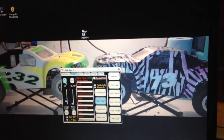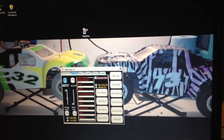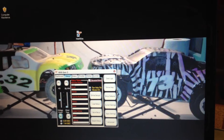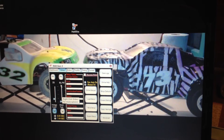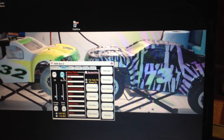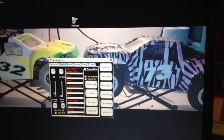Right here are up and down arrows — not V's. You can click them to cycle through your options. It will tell you your voltage cutoff; I'm going to leave mine at 2S. Then right here you have what type of motor you are running. This is BL brushless forward only, then you have BL forward immediate reverse, and then forward delay reverse. For racing, you are going to want forward only.